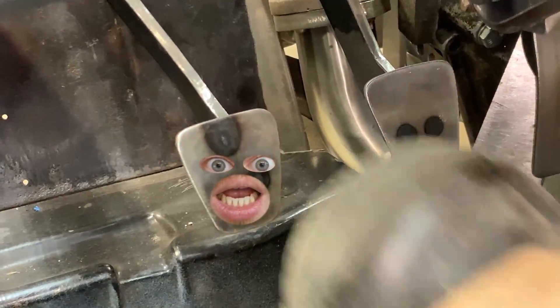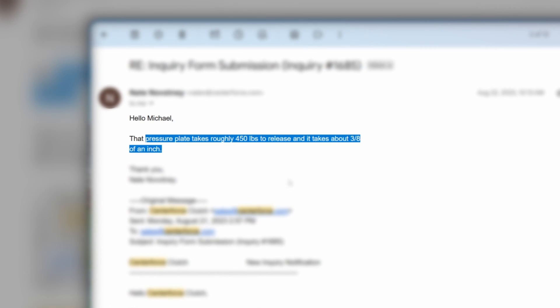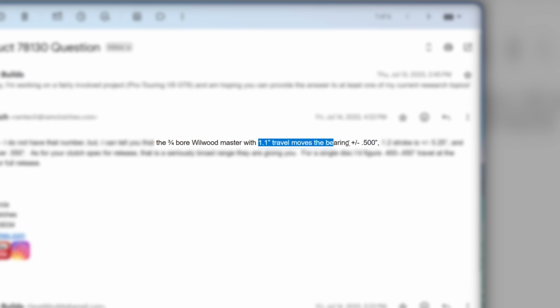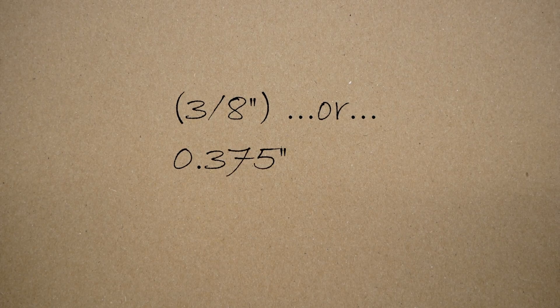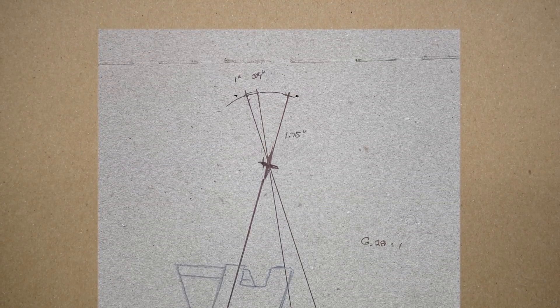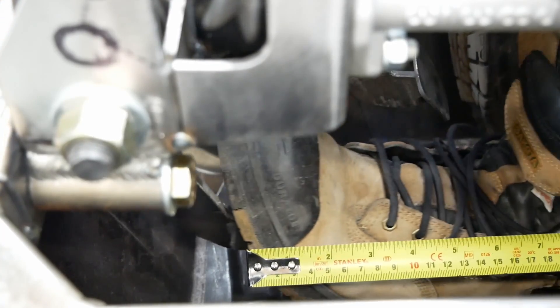Getting the clutch to fully release requires effort and a specific amount of motion, so to be sure we build a pedal that works, we must do some calculations. According to Centerforce, our pressure plate requires 450 pounds of effort and three-eighths of an inch of travel on the fingers to fully release. Our release bearing requires a three-quarter inch master cylinder to be actuated 1.1 inches for the bearing to travel half an inch. When considered as a ratio, that's 2.2 to 1. So 0.375 multiplied by 2.2 is 0.825 — a little under seven-eighths of an inch of master cylinder travel to disengage our clutch. With some cardboard-aided design, we sketch out the pedal length, and the lever just needs to move seven-eighths of an inch for whatever travel we desire at our foot — in this case about five inches — which translates to a 6.29 to 1 ratio.